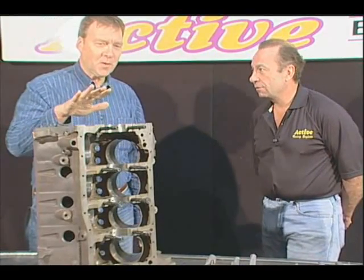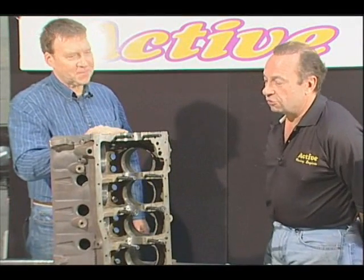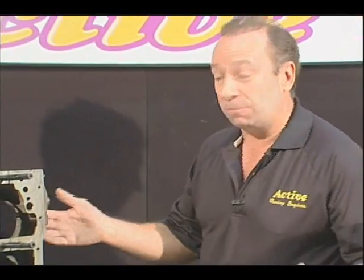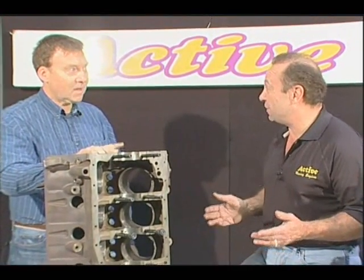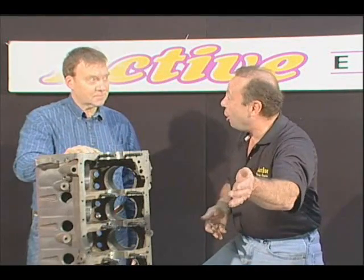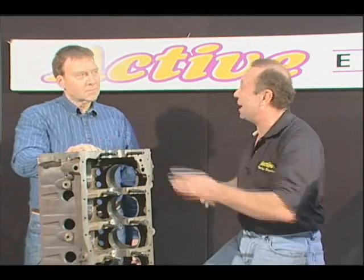So blueprinting sounds to me like you are assembling and reassembling the motor a number of times before you actually assembled it for its final... certainly it's got to be checked and rechecked. You want to make sure when you're doing any of this type of work — for both the bores and the main saddles — we actually allow cool down time. Because believe it or not, just doing the machining causes some heat transfer, and both the main saddles and the bores may actually shrink thousandths of an inch after you finish machining. So we'll take it out to where we think it should be, walk away, do something else, come back and check it. In the case of the main caps, we actually take them off and put them back on to make sure the housing bores are still correct — just to be doubly sure.